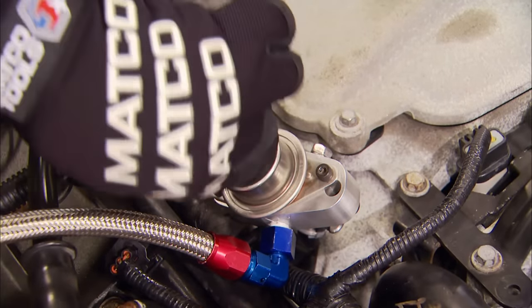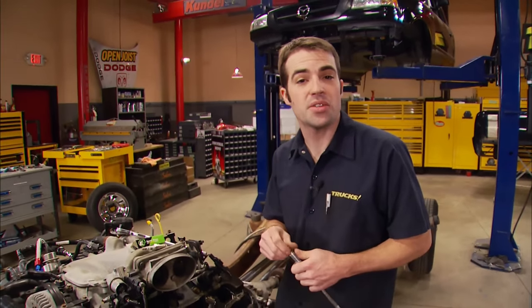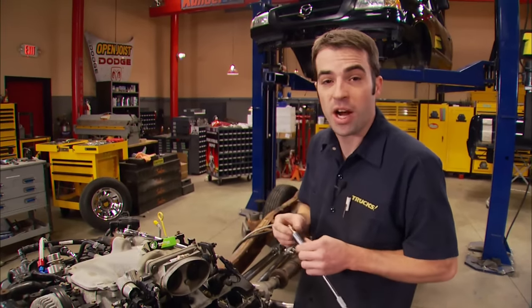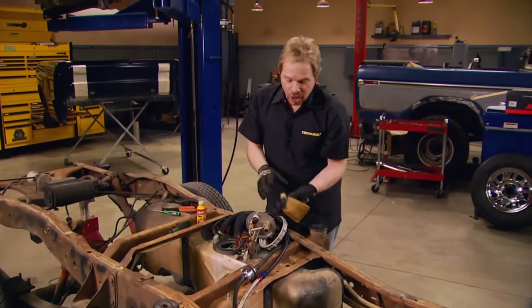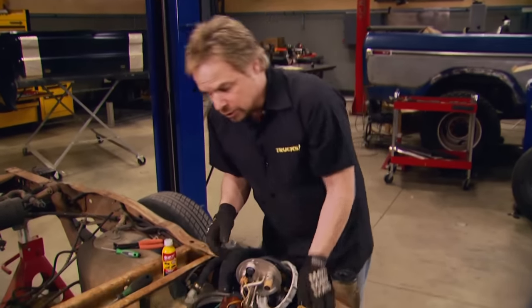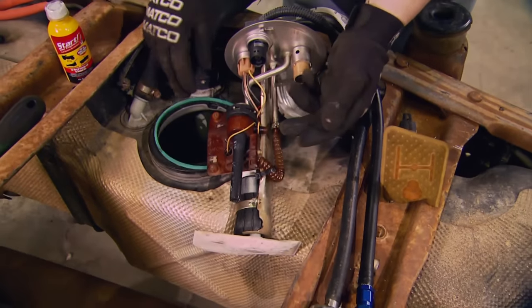The vacuum reference hose is installed under the fuel pressure regulator. Since we don't know the overall condition or how many miles are on the original Mercury Marauder spark plugs, we're going to replace them with a fresh set of E3 Diamond Fire plugs. It's pretty safe to assume that the stock fuel pump is not going to supply the demands of a big V8 engine — this was made for an inline four-cylinder. So we went to O'Reilly Auto Parts and got a Mercury Marauder fuel pump and put it in line. We also clipped the return line so it wouldn't get internally regulated, but just flow freely into the tank. Now we know our fuel pump is going to match the demands of the engine because that's what it's made for.